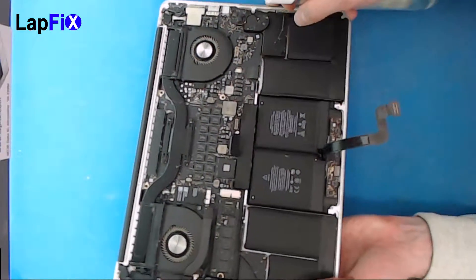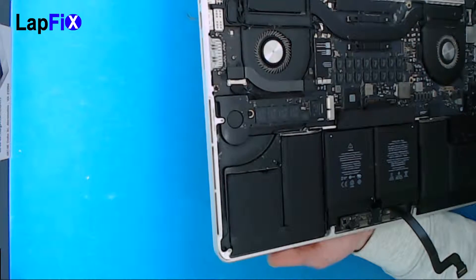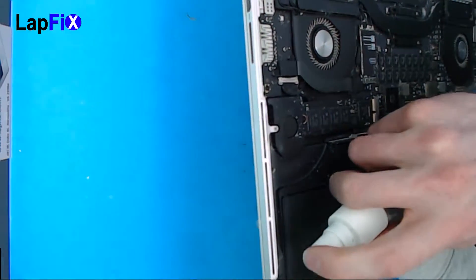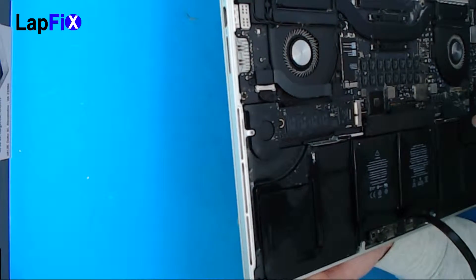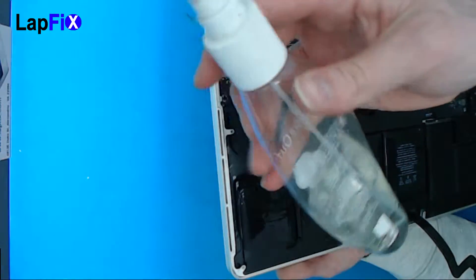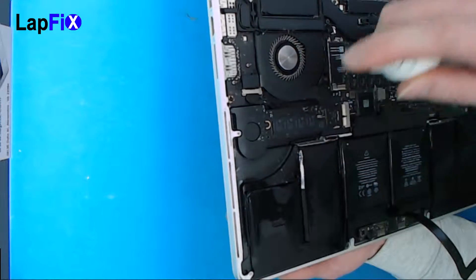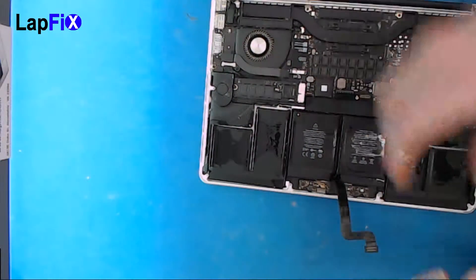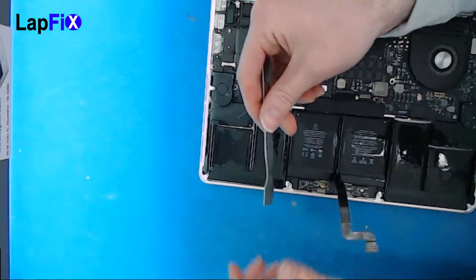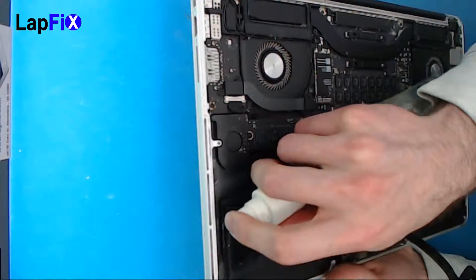So we're going to be spraying it and actually lifting it up like this, just spraying in this direction so when it drips, it goes down and gets the other adhesive we're missing as well. We're starting on this side — just use a little alcohol like that. You can spray it into little crevices; you want it to sit. Alcohol doesn't really harm electronics. Try to get the highest percentage you can — we have 90% here, but try to get 99% if you can; it would be a little better and safer. This is a really good wedge tool we like to use. It's pretty stiff — you really just need a wedge tool so you can get down here and try to remove each part. If you ever struggle at any point, definitely just keep using more alcohol and it will make it much easier for yourself.